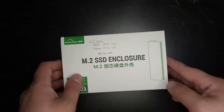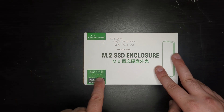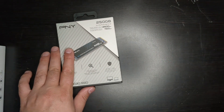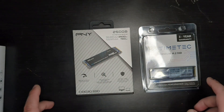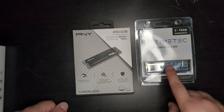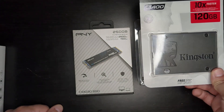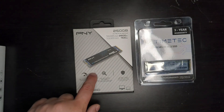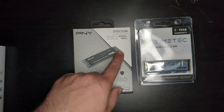I already tested it and it works well. This is a dual docking station — it does NVMe and SATA. What that means is I wasn't able to find so frequently a dock that does both SATA and NVMe, because there are two different types of M.2 SSDs. The SATA protocol ones run on the same protocol as a regular 2.5-inch SATA drive, and the NVMe one runs on the PCIe protocol — you can tell that by the key on that side, which I believe is called the M key.